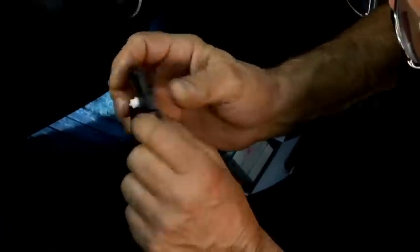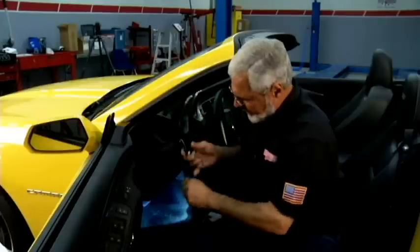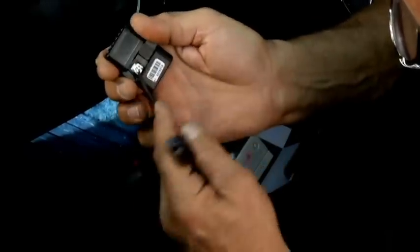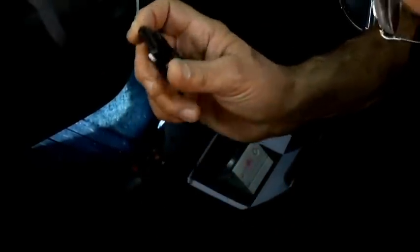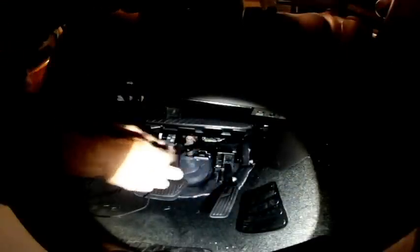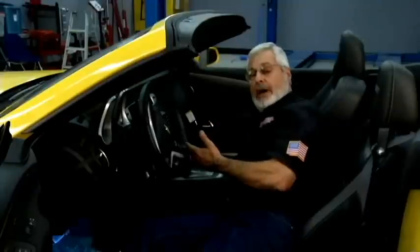And here's our Sprint Booster. Now, it's programmable. We're going to leave the selector switch with the lights on it. So now's a good time to plug it in. This plugs into the side. It clips. This is really simple. I've got the wire harness disconnected off of the throttle position sensor. We'll plug this onto the throttle position sensor, plug the harness back into it. Bingo, it's done. That's the complete installation of the Sprint Power Booster.